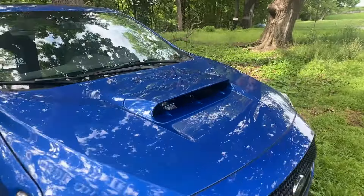I'm getting severe hood lift at like 80-plus miles an hour. I don't think it's going to cause any damage, but it's noticeable — I can visibly see the hood lifting while I'm driving. So I'd like to get those pressures relieved underneath the hood and I'll design a set of hood louvers for this car.